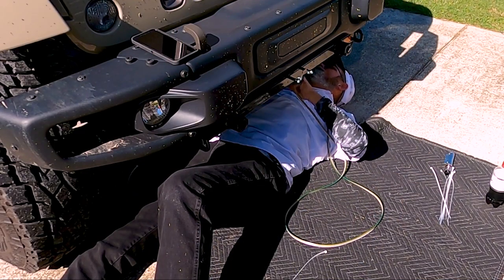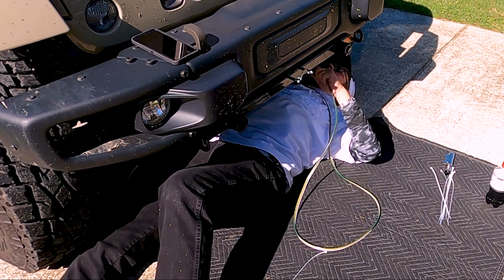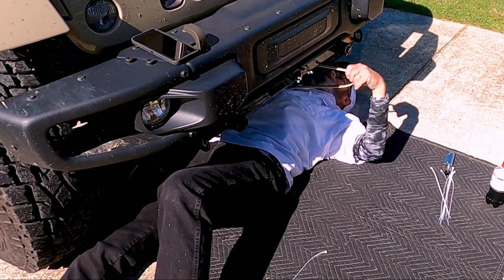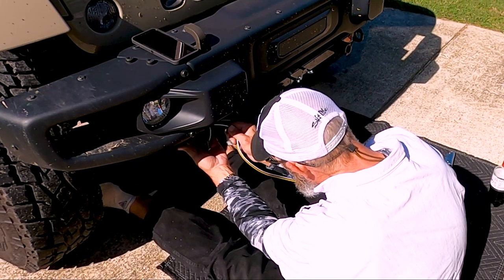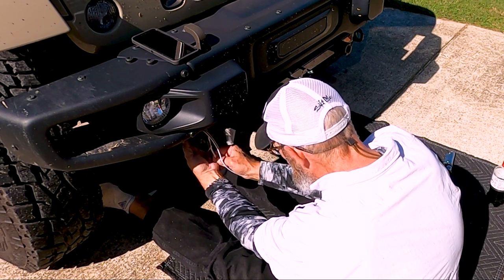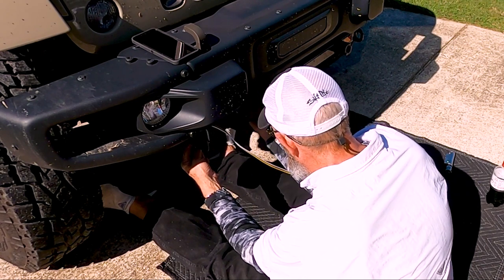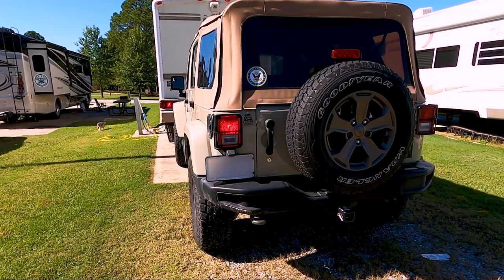This part of the wiring project is temporary, so Ricky ran the full length of signal wiring along the base plate, securing it with cable ties. In part 3 of this series, he will install the permanent 6-pin connectors to the towed vehicle and the RV. For now he has attached a 4-pin connector, which matches the current connector on the RV. Finish this part of the install by testing the lights thoroughly.